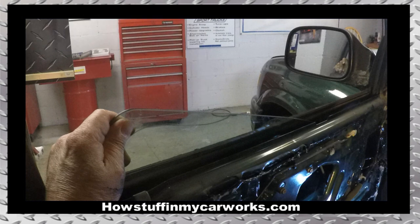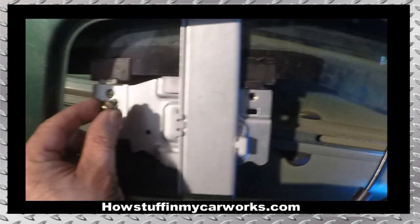Slide the left upper retaining bolt through the opening and allow the regulator to slide down to its mounting location. Align and install all the other screws. Once all of them are installed, tighten them up, and do the same with the three window motor retaining bolts. Pull on the back side of the glass upwards with one hand and guide the other side into the window track, followed by the side you lifted up first. Next, guide the glass into the window regulator bracket, install the two retaining bolts, and tighten them up.